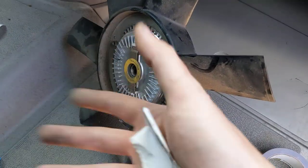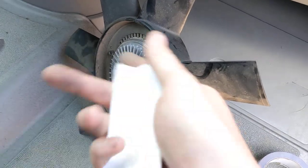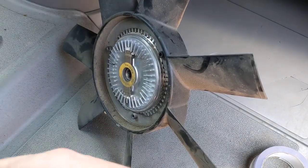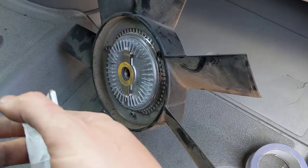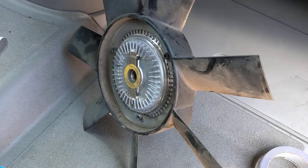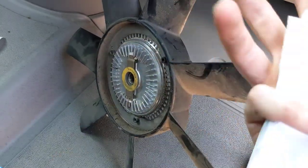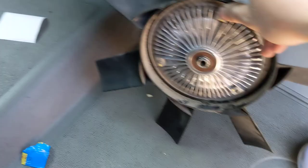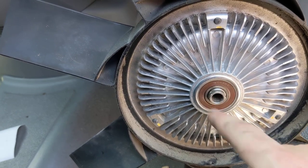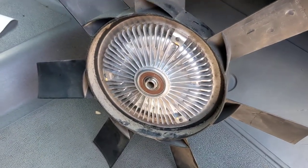Another way these can fail is they can fail always on, which is also bad. You'll be able to diagnose this when you turn it on — you'll hear what's called fan roar, and it just makes a very loud roaring noise. It will continue regardless of whether the vehicle is hot or cold. If you get your vehicle really hot on a good functioning fan clutch you will hear fan roar, but that's because it's what it's supposed to do when it gets to 230 degrees or whatever and kicks on. A lot of times you can tell if it's bad — this little bearing back here will be split, there'll be missing bearings, and it basically gets locked in one position, which puts unnecessary load on your motor and other bad things.